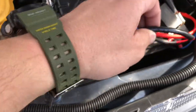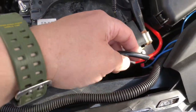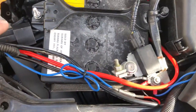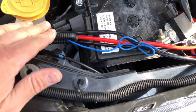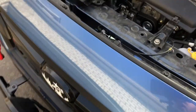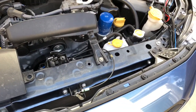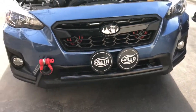At the relay you've got your ground and your power. That's my ground, there's my power, and that's the wire coming from the switch right there — splice it in there. This one's grounded as well to the negative terminal. It's a little bulky in there just because the wires were a bit shorter; I probably could have lengthened everything and spliced more wires in. But everything worked, and it looks clean from the front end — there's a cover that goes on here that you've probably seen in my other videos, so you can't really see any wires hanging down.